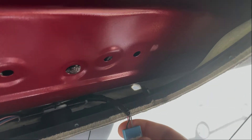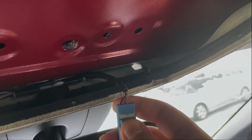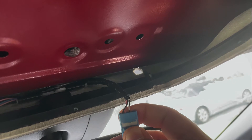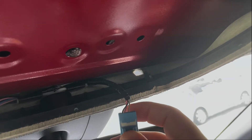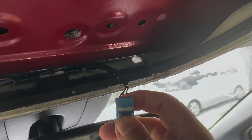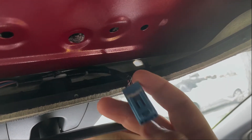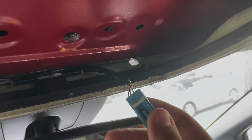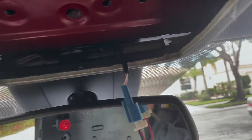As you can see here, the black is for the 12-volt always-on, the pinkish-red one is ignition, and the white-black one is for ground. The pins I used are the second one in — the pink one — and the ground on the far right in the connector.